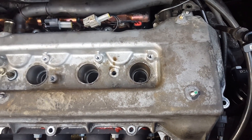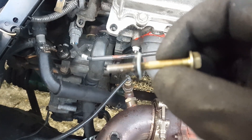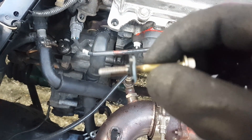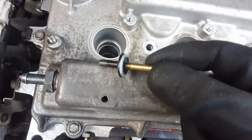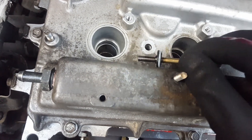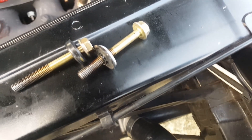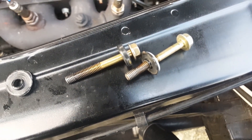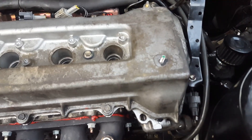I'm just going to torque it all down now. You're supposed to torque it down to 10 newton meters. So these are the middle screws I showed you earlier that were stuck to the rocker cover — look at the state of that gasket or washer. Here's the new one and there's your old one side by side — bloody hell, what a difference!